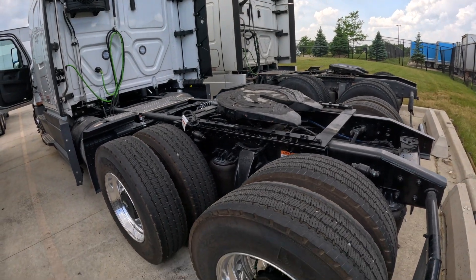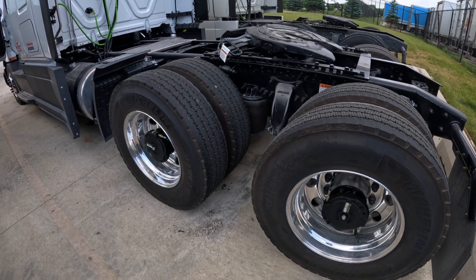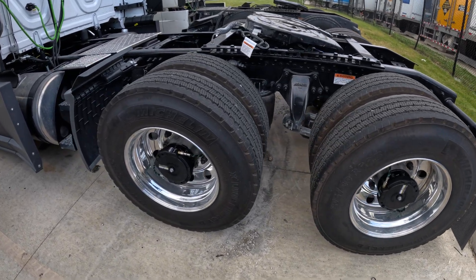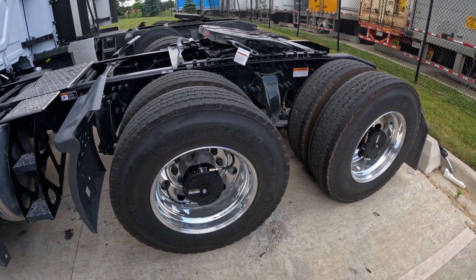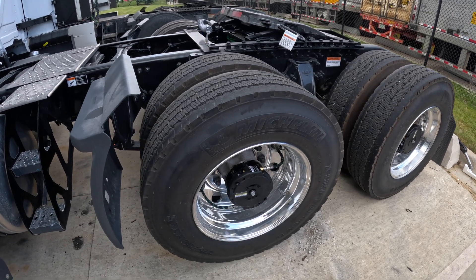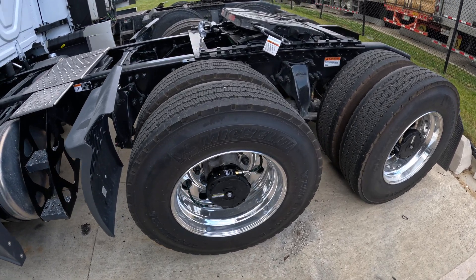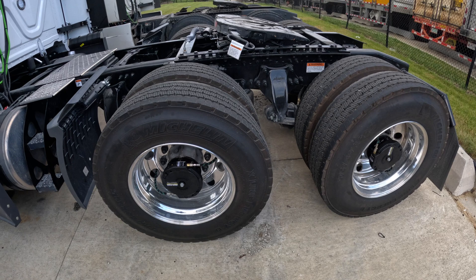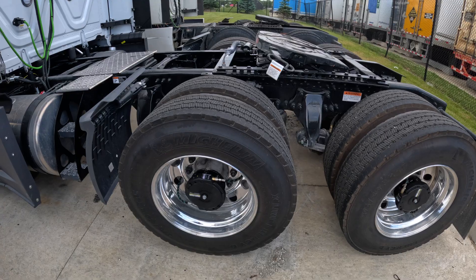Hello, my name is Ben. Today I would like to show you how to turn on the differential on a brand new 2024 Freightliner Cascadia. Let's say your truck got stuck in a facility on gravel, sand, maybe it's winter time, stuck on ice, or you pulled under a trailer and cannot move out — the wheels are spinning, slipping, only one axle is digging in. The more you dig in, the more trouble you'll have. What I recommend is locking up the differential, turning off the traction control, and trying to move out.